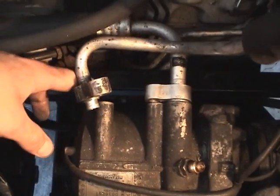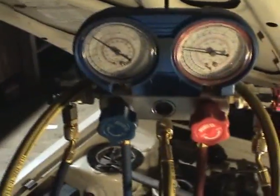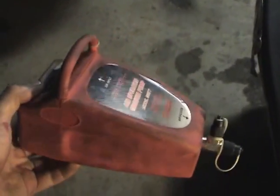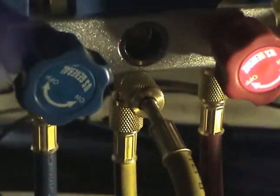That completes the actual physical part of the AC system. This is the AC gauge kit I bought from Harbor Freight — about $45 and well worth it. In my opinion, this is the only way to go if you're going to service your own AC system. I also purchased a siphon pump for only $10. Basically, you hook up your compressor to this side and hook up the yellow hose from the top port onto the fitting on the end. Turn on your compressor and it will draw a vacuum. Before you do that, connect the blue hose to your low side on the compressor — it's got a quick fitting on it, so it's very convenient.